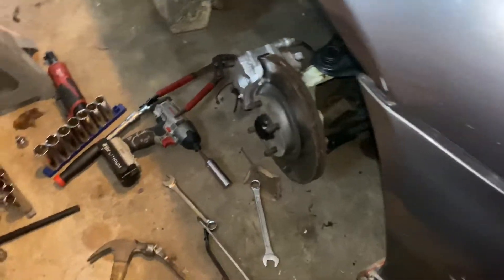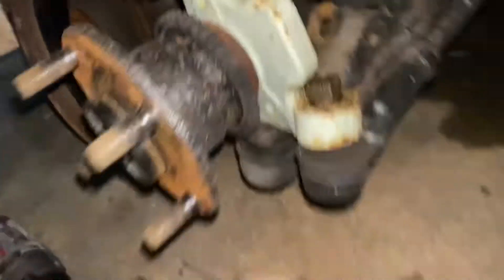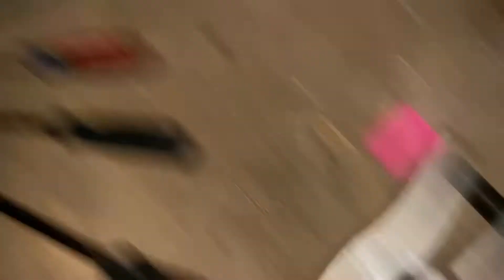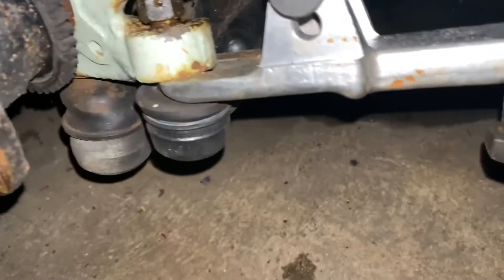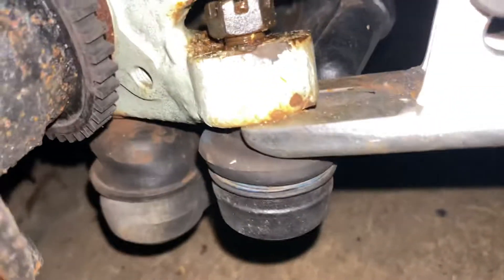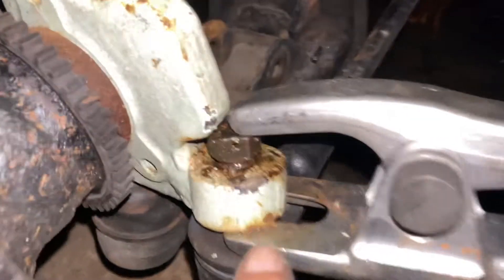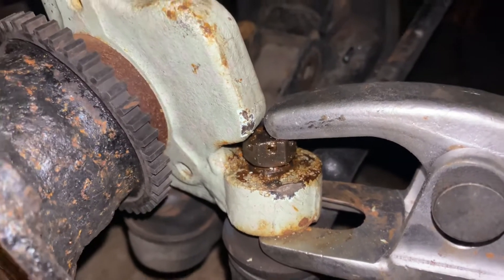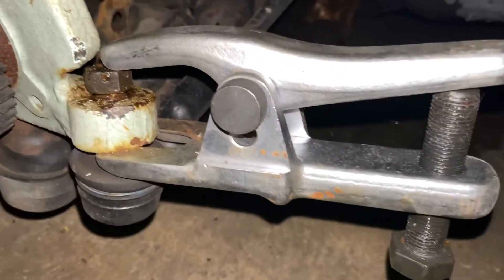Now I'm going to turn this part. Coilovers out, got the tie rod loose. I'm going to use my ball joint tool to blow it out. It doesn't want to blow out — must be very rusty. You see how it works? It lifts the knuckle up and forces the tie rod down, causing it to separate. It can get really tight and make a loud bang.